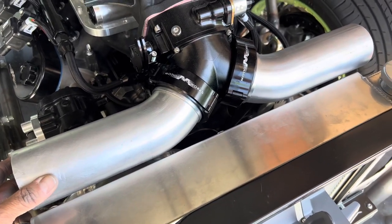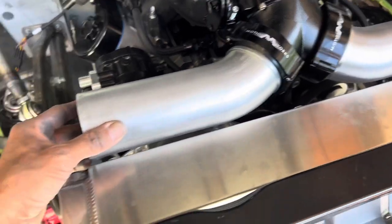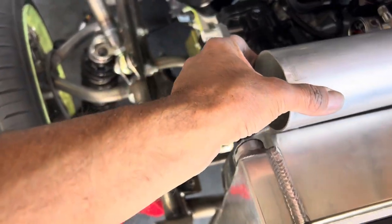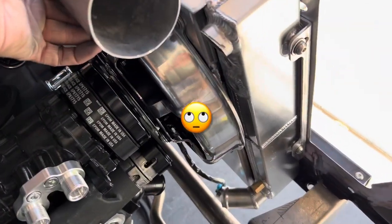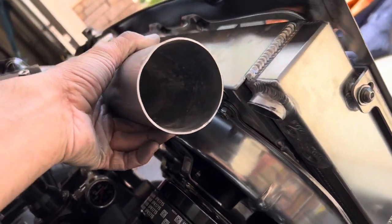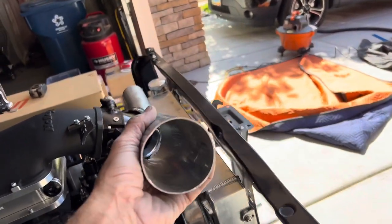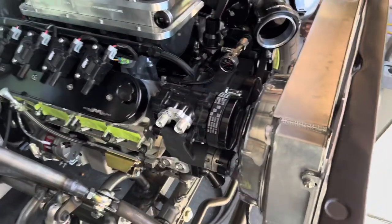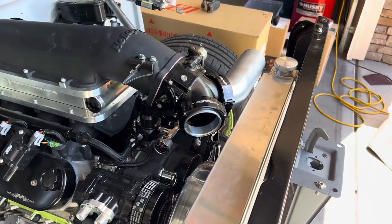These two pieces of aluminum I cut from the previous throttle body actually line up pretty well — both stuck into the flanges. The only issue is I had to cut off this nipple to clear this area, so I'm going to have to weld it back on at an angle so it comes down beneath the intake pipe. This is three inch intake pipe, so I'm going to try to go with three inch pipe as far as I can. I do have a three inch to two and a half inch rubber coupler that will go to the turbo. Let's just proceed with optimism.